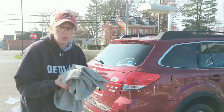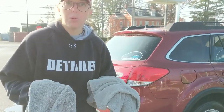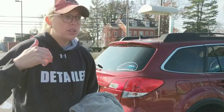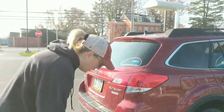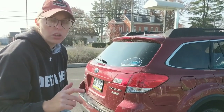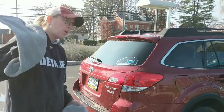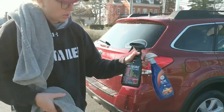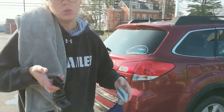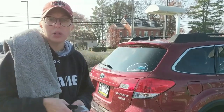You want to have a soft drying method. My favorite for drying is something that is a plush microfiber — Autofiber Dreadnoughts are probably my number one, or the luxury microfiber drying towels. Griot's Garage has some fantastic ones too. If you don't have a ceramic coating and you just have a spray wax or sealant, use a spray wax as a drying aid. Options include Turtle Wax Ice Spray Wax, their Seal and Shine, or Duragloss Aqua Wax. These give you about two to three months of protection but aren't highly chemically resistant — they won't fully withstand road salts, but will give you enough protection between washes.